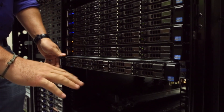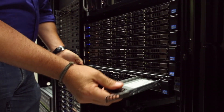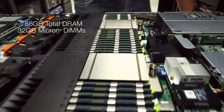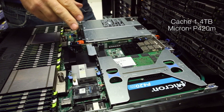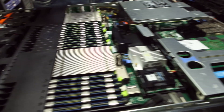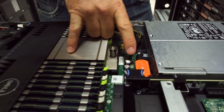For the mass storage, we're using 10 client drives. These are the M500 1TB drives. For RAM, we have 768GB of RAM. We're using 32GB DIMMs. For the cache devices, we're using our PCIe P420M — those are 1.4TB. The storage controller on this is the H710. And because all of the drive slots and PCIe slots have been used, we're using the Lexar USB to actually boot the ESX operating system.